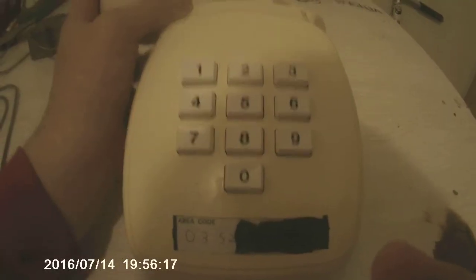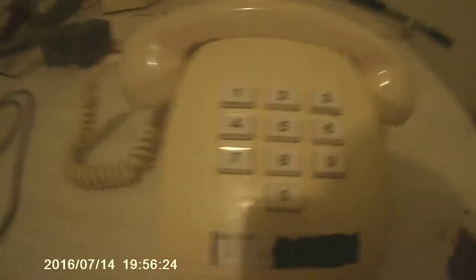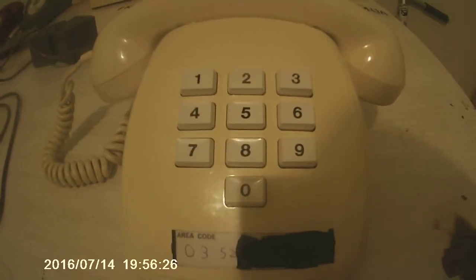I had to replace the bell on this telephone. The bell was stuffed up — the motorised coil was not working, it wouldn't ring the bell. I took the bells out and put a little round bell about that big inside so it would ring. I still have the original bell. I'm going to switch this over to the 12-key now but I'll do it in a separate video.